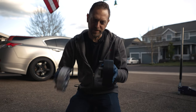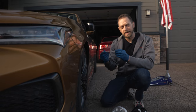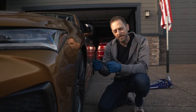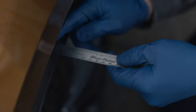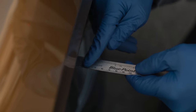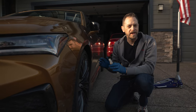H&R spacers are available in silver and in black. You can see these are the 25s and these are the 20s, so there's quite a bit more thickness. So you're going to get some wheel spacers, but what size should you buy? A little ruler is all you need — line it up against the tire, measure against the fender, and find out exactly how thick your spacers should be. They usually come in 5mm increments, so it's pretty easy to nail down what size to get. Grab a tape measure, put it against the fender, and get a visual. It looks like between 20 and 25mm is going to get us pretty flush with the fender. 20 might be the safer bet; 25 would definitely look cool but maybe pushing it. I'm going to try 20s on one side and 25s on the other to see the difference and find out if it's going to rub or not.